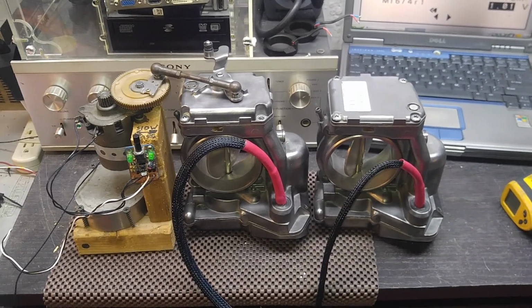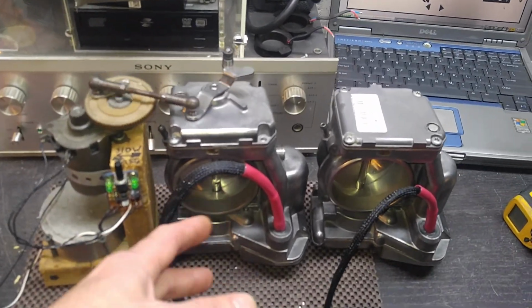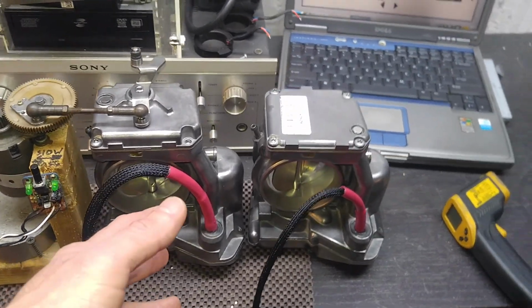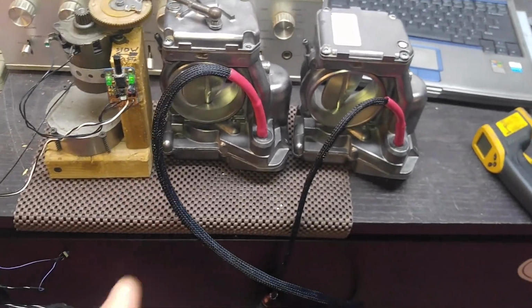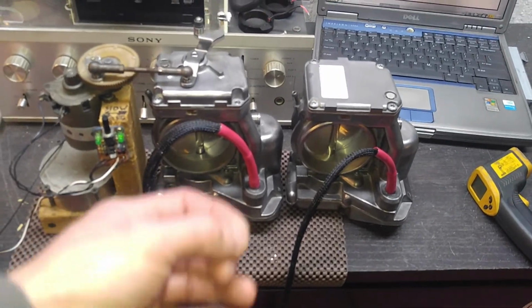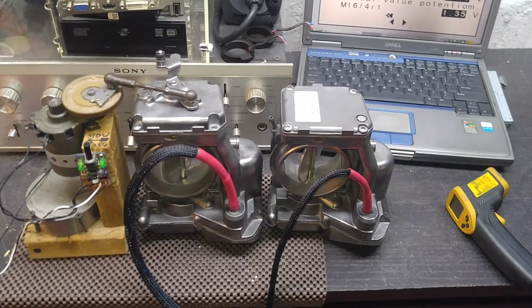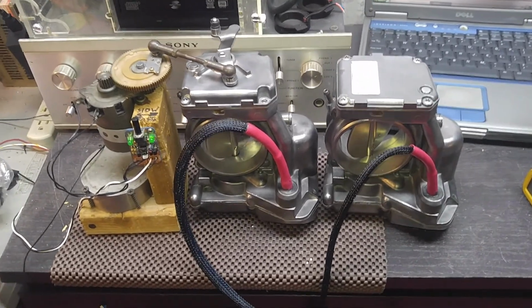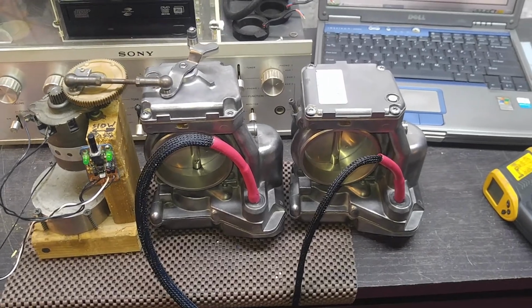I couldn't even start checking them out because of the way that they were soldered, and some points were overheated. The connections inside the connector were like bare cables with some heat shrink wrap. I mean, yeah, they seem to go all the way down, but I don't know. It was a mess. The wire gauge was different. It was not the right wire gauge, so that is another thing.